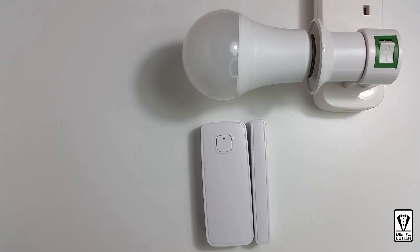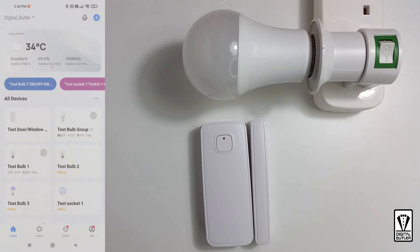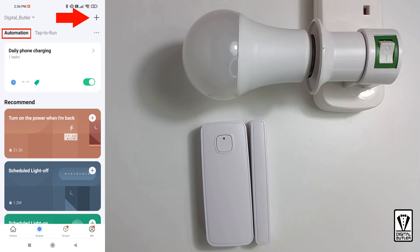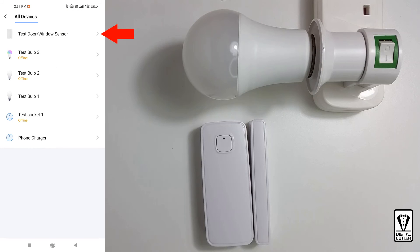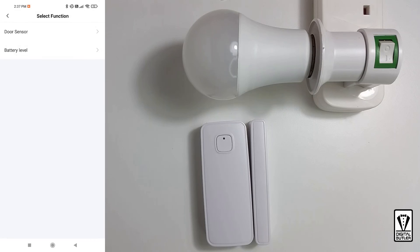As you can see, I've added a bulb here. This bulb is named test bulb 1. If you want to know how to set up and pair the bulb to your app, I have made a video for it — just click here to go to that video. I've also renamed our door sensor to test door window sensor. With the hardware set up, let's begin. Starting from the home screen of our app, we proceed to add an automation. We want to set up a condition to trigger the automation, so we will choose when device status changes. Select test door or window sensor and start the automation when the door opens.